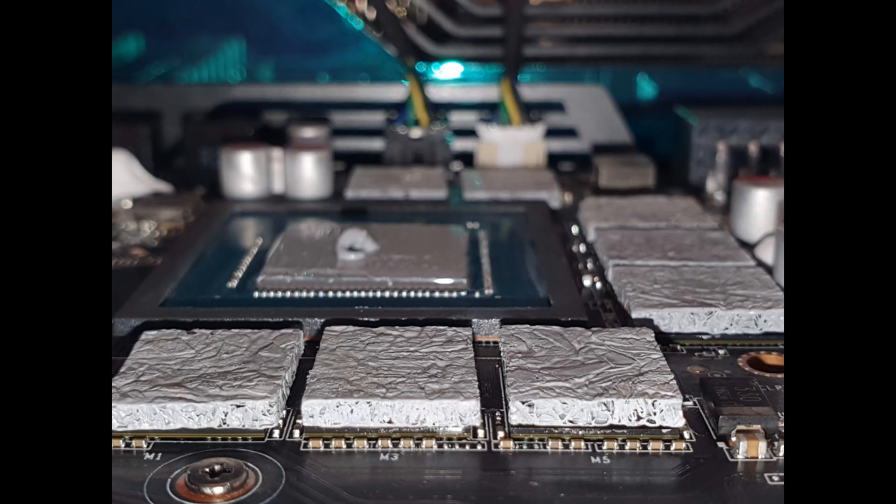I'm pretty happy with those results. My test bench is a computer case with decent airflow, enough case fans, and only a single GPU at a time while testing. I've sent this card back to my friend who let me borrow it, and he's going to put it in his rig next to other cards and let me know what the temperatures are — I'll update you guys on that since we want data from these cards in a hot rig. I'll also swap my own card into a seven-card rig, sandwich it in the middle, and see what the temperatures do so we have that for reference.